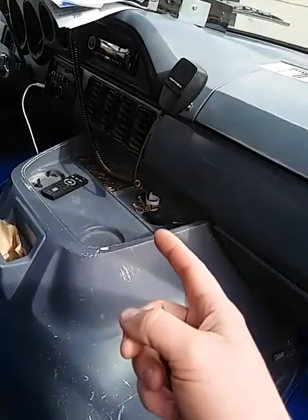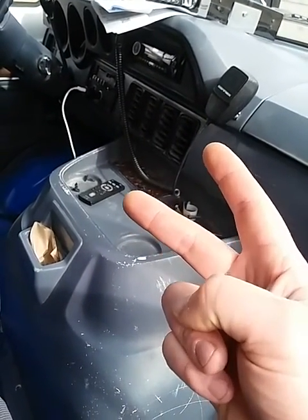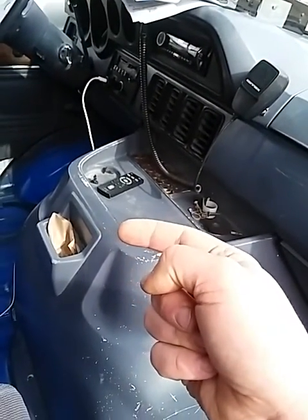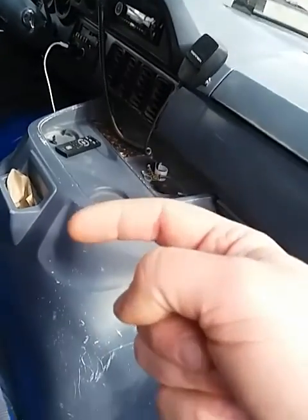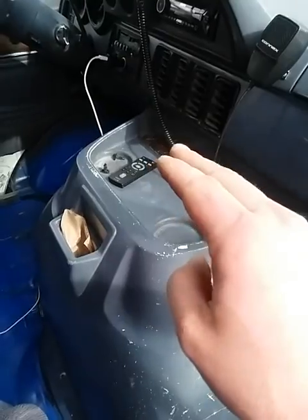So I ended up having to pull that out, and it came out in 4 pieces. After I got the brass piece punched through, it fell into the motor, and the spring went to the back of my plenum, so I had to use a magnet and run it down and try to chase it. Fought that for 30 minutes, pulled it out successfully, got everything cleaned up on the hose and also the plenum,